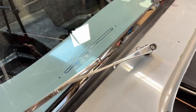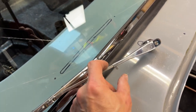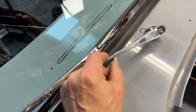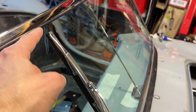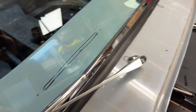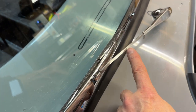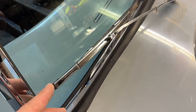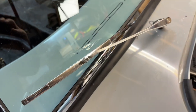Once fitted there are a couple of adjustments you can do. You can lengthen the windscreen wiper arm by undoing this little arm — it will release and let it slide in and out. Push it back up in line underneath — you need to push quite hard. You might need to adjust the height if it's hitting the end of its sweep. If the wiper isn't quite flush to the windscreen, it's not unknown to need to put a slight bend in the arm to hold it in its lower position. Mine's practically flush but I'll just give it a tweak. That's how you fit a windscreen wiper.